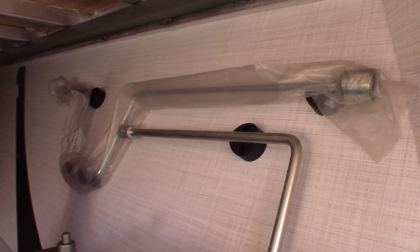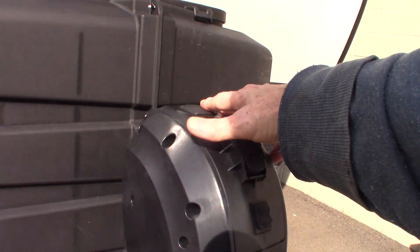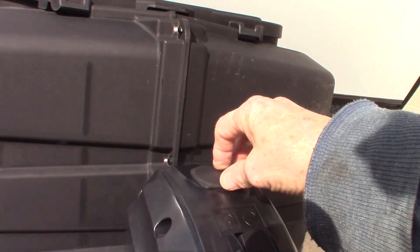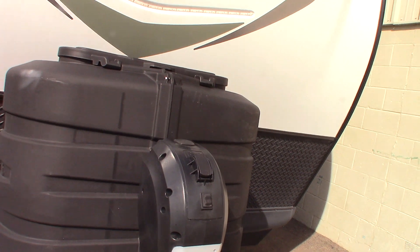When it comes to your cranks, you've got a normal 3/4-inch crank, and then you have the smaller one right here — that's for the power tongue jack. If the power tongue jack happens to fail, you can pull this plug out of the top, put the crank on there, and crank it manually. So you can always get a hitch and unhitch no matter what.